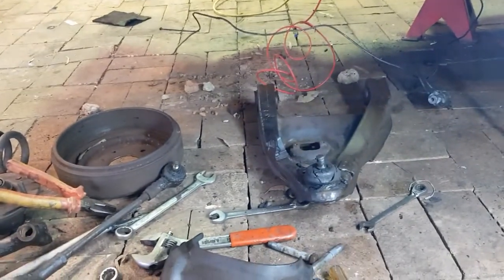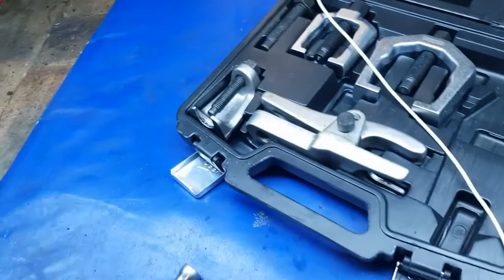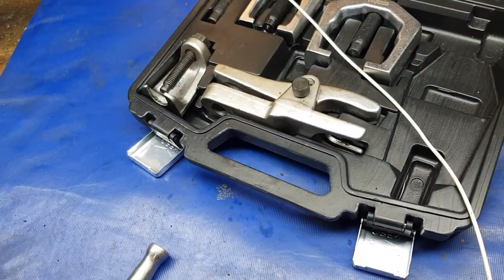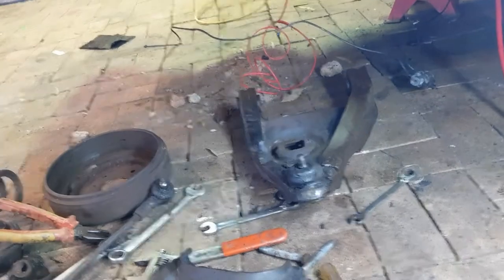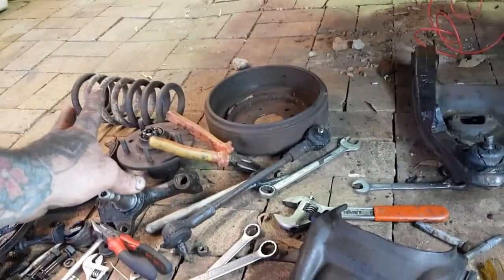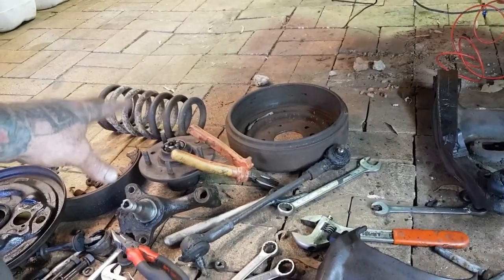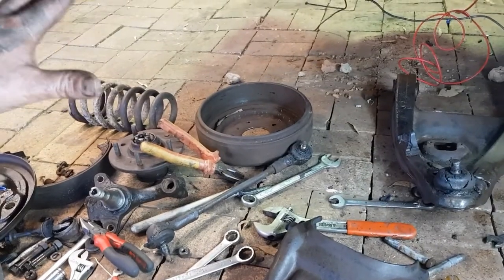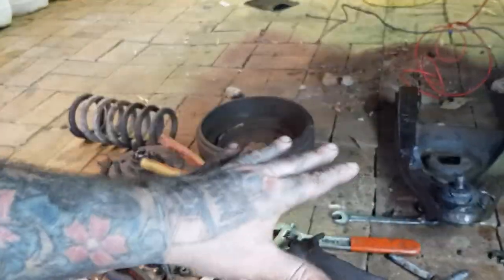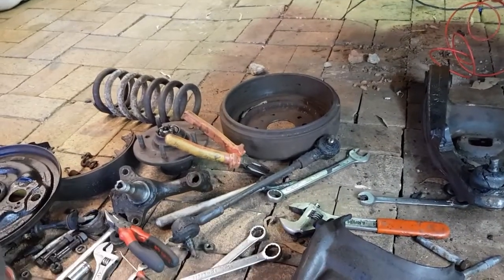So you would have seen, I just kept going. We had to get one of the ball joint separators on the ball joint there to get it off the spindle, and then you would have just seen that thing pop. Now, here is a tip for you. I didn't have to do it because my shocker was undone, and I've got chop springs. There was chop springs in this thing because we are lowering this car, and we chopped the springs to lower it temporarily to make sure we get how low we want, to know exactly what springs I want to buy, whether it's 2-inch lowered, 3-inch lowered, 1-inch lowered, right?